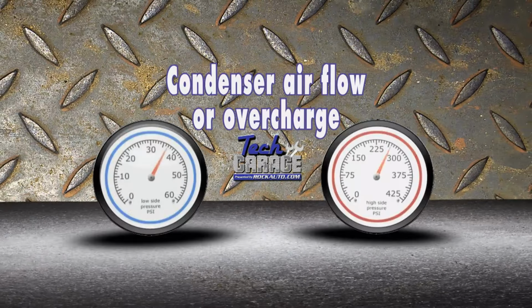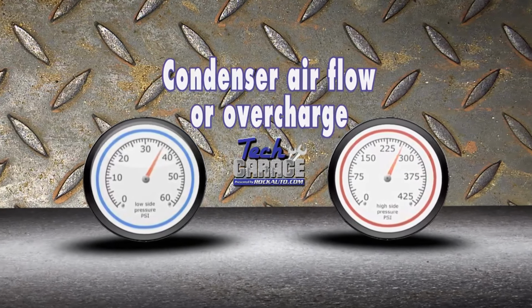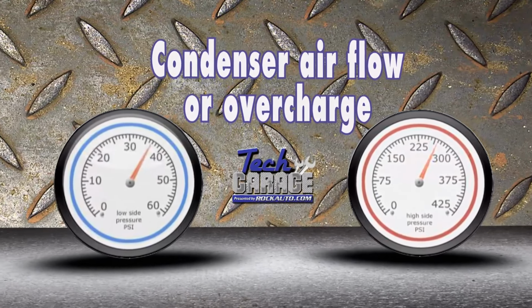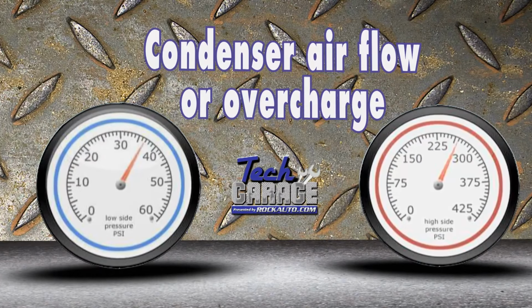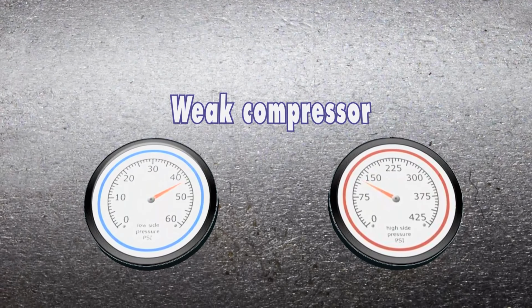Exactly what's going on the low side. Now, condenser airflow, or overcharge. Too much refrigerant in the system. It starts to get hot in the front up here. Once it gets hot, look, they're both going to climb up a little bit. So what's happening? The low side's high, the high side's high. Usually a restriction of airflow in the condenser. And last but not least, almost similar to ours, Brian, is that weak compressor, man.